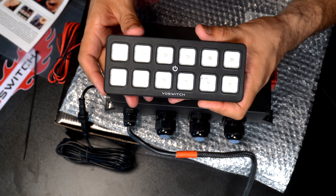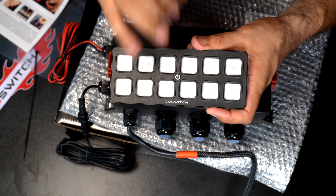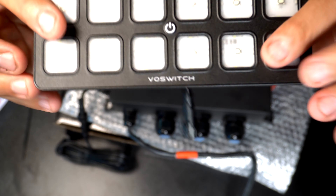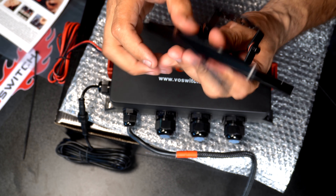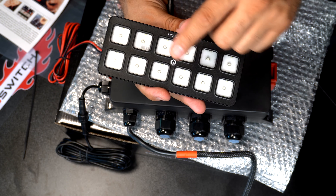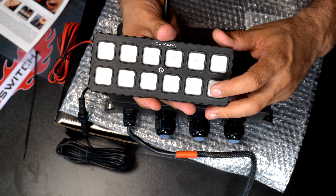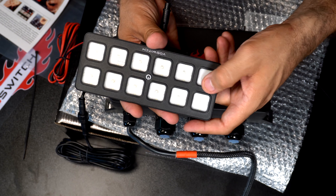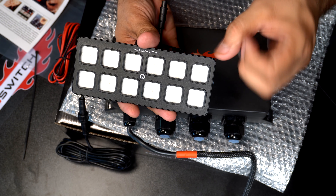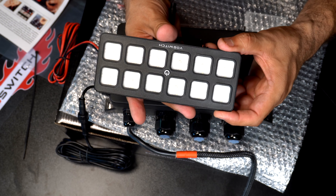What's neat about the switch panel is it's programmable, so you could program it to do a momentary, stay on completely, do a flash, or do a strobe feature. This construction of this switch panel is awesome. You could also program the colors from white to green to red to blue — another awesome feature. And then obviously on and off. You could also do an up and down switch, so if you wanted to do some type of audio system or fan system, you could program it: press this button and it'll bring up the fan or whatever it is, or go down and it'll bring it down. You can do that with any two switches on this Voswitch panel.